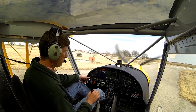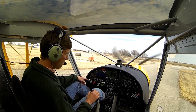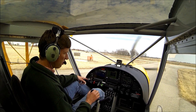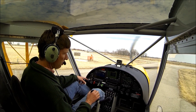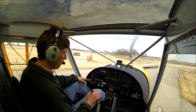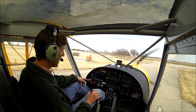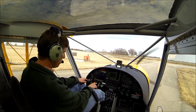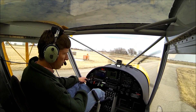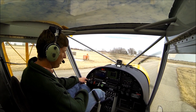We're going to run it up to 4,000 RPM. We're going to check each ignition — lane A and lane B. We're going to turn off lane A; the light should come on for lane A, and our B circuit is actually working.